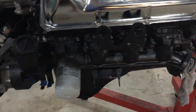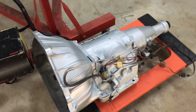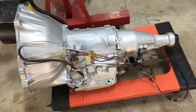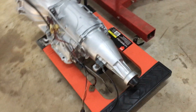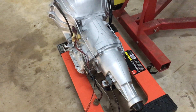Looking good — it's done. Transmission's done, staying with an FMX, so that's all been redone — serviced and cleaned, bands are all done, new seals and all that. The tail shafts are at the shop to get new unis on them, so they'll be back next week.